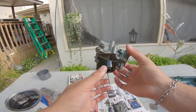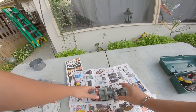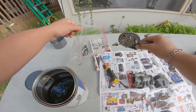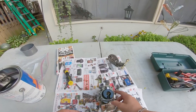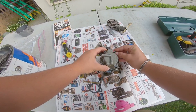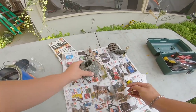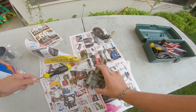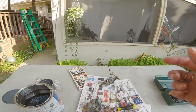This should be pretty simple — I'm just going to put it back together for now, and once I get the motor stand I'll do the lower unit and all that. I just gotta stay on task and put this carb back together. Float's on — just get these screws in lightly, make sure everything lines up. It's all back together. I'm going to put the needle in now — it was super tight because of that little bushing, so I'll see if it goes in the same way it came out.